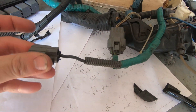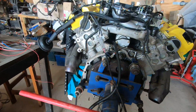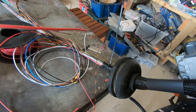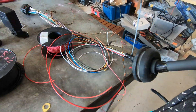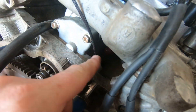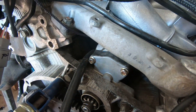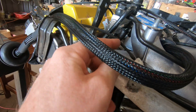Here is the start wire that was on this vehicle. I've made some changes — there's a start wire that pops out here, so we can put the start trigger there. The wire going into the starter motor comes out the right-hand side of my loom, but if we want to go directly to the other one we can tuck it out the left-hand side. It should be long enough to reach the van's original trigger and this one just becomes a spare.